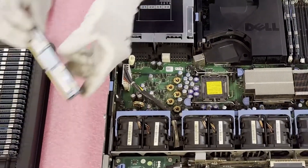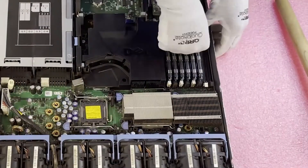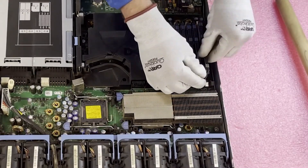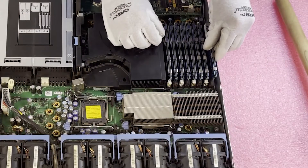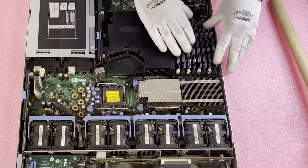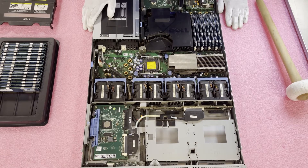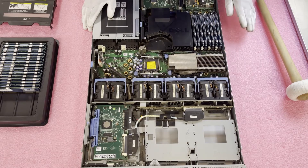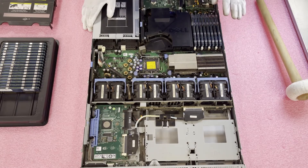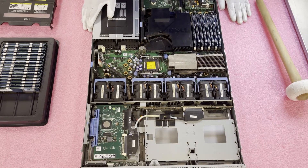I'm going to go ahead and finish loading these up. And voila — just like that, it took maybe 30 seconds to a minute and you can knock out eight DIMMs with ease. If you're using a machine like this and just trying to extend the life of it until you can get a newer machine, honestly the cheapest and easiest thing to do is upgrade your RAM for roughly a hundred bucks, probably less. You can upgrade all eight DIMMs and put this at 64 gigabytes — it's really the only way to go with this machine.